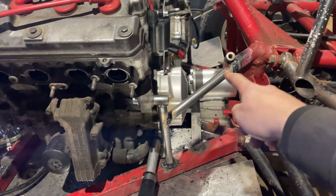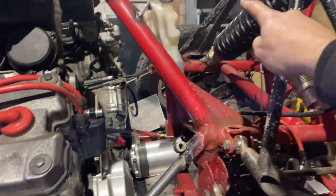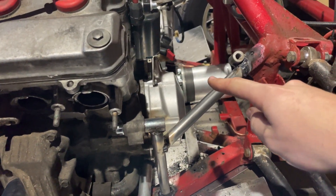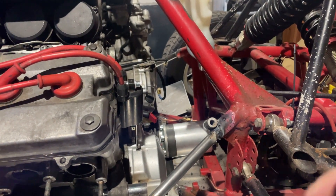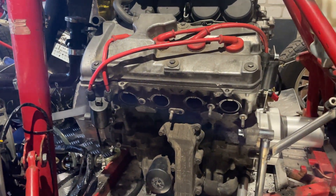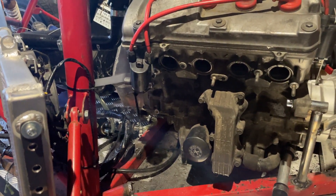This bar is in and the other side is welded in as well. I also welded in this bushing so once we complete the exhaust system it'll go over there and onto the damper — mounting only on the engine isn't enough. We'll do a 180-degree turn and make a plate that mounts onto there, with a normal M10 thread. I put some real force on it and it doesn't move a single millimeter — that's a positive thing. Only one more tube mount to do and then this is finished.